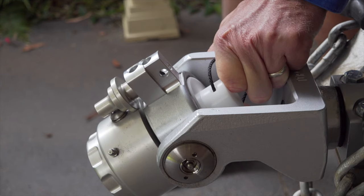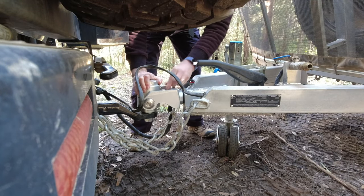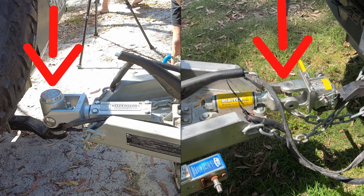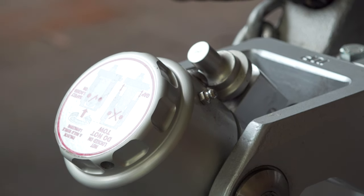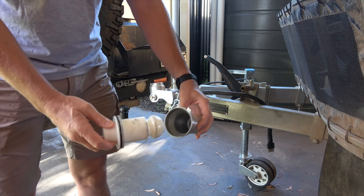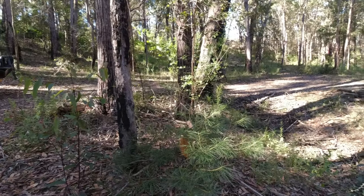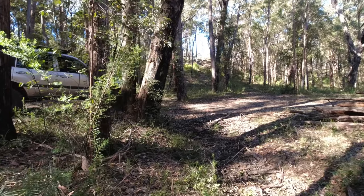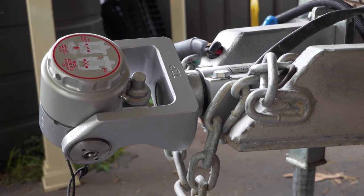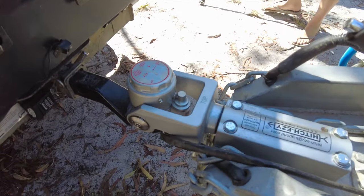The Hitch Easy has two coupling methods: the traditional drop-over approach where you raise the jockey wheel and lower it over the tow pillar, or the back-into coupling technique — which I prefer because I don't need to raise the jockey wheel as high. I love the automatic double locking, making hitching a hands-free affair. For unhitching, I use one hand to unlock and the second to wind the jockey wheel up a few turns. The hitch has few moving parts, is sealed on top — no dirt, dust, or mud ingress — and includes a dummy tow bar pillar and aluminium cover for when not hitched. You can also lock it with a padlock, it's compatible with weight distribution systems, can be mounted on top or under the drawbar, and is ADR6202 compliant and low profile to minimize tailgate clearance issues.